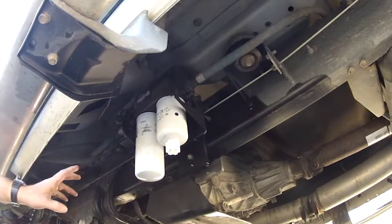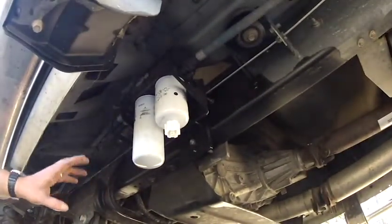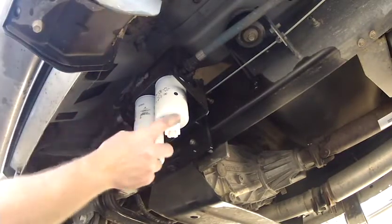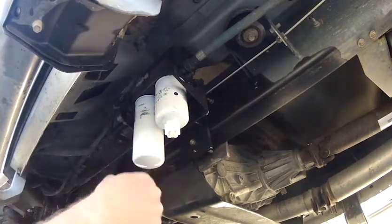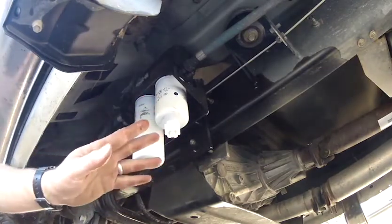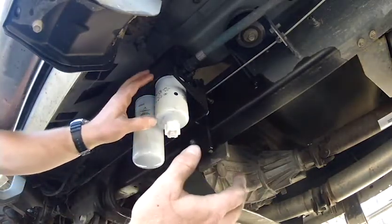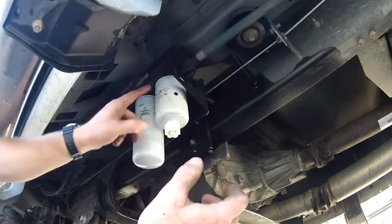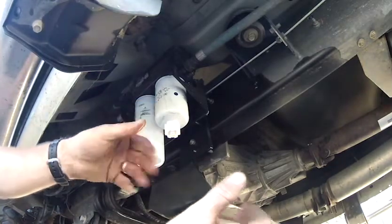Now, my assumption is that the fuel filter at top was breaking suction, so I put the filter back in there and the housing back on, and tightened everything up. Then I took the water fuel separator filter off, and I took that off-road diesel. On their website, Airdog tells you that if you can't get prime, which is what was happening, put your finger on the stub that this fuel water separator fits onto and see if it has suction. It did. It wasn't a lot of suction, granted, but you could tell it had a little bit.